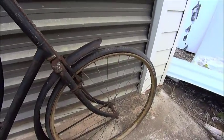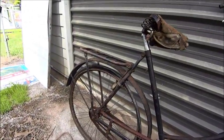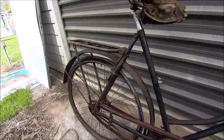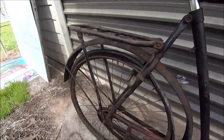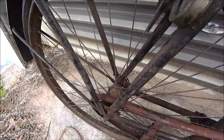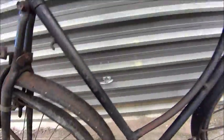This is a 665 rim and this one's only a 635 on the back, which I'm told is the wrong one. It is the right width but it's got the wrong hub in it — it's got a coaster brake, which is not correct. It should have a mechanical brake, rod-operated, the same as the front one.